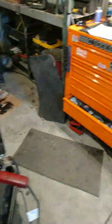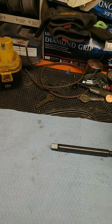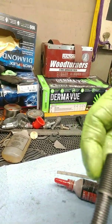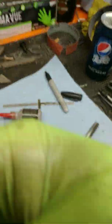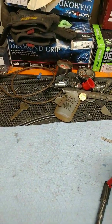This Time-Sert kit comes with insertion oil — driver tool oil. Put a few drops on there and roll it around. Something to do with the way the threads are cut on the insertion tool helps the insert lock into place. It also comes with Time-Sert thread lock, which is basically a thread locker like Loctite. Put a little bit on there, try to get it on both sides at the very bottom.